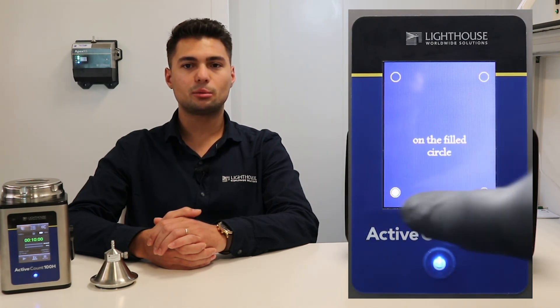If the screen needs to be calibrated for any reason, touch the screen with your finger while the device is turned off and wait. If you press the power button while your finger is on the screen, you will be directed to the screen calibration menu. After following the steps on the screen, you must restart the device. In this way, the touch screen will be calibrated.